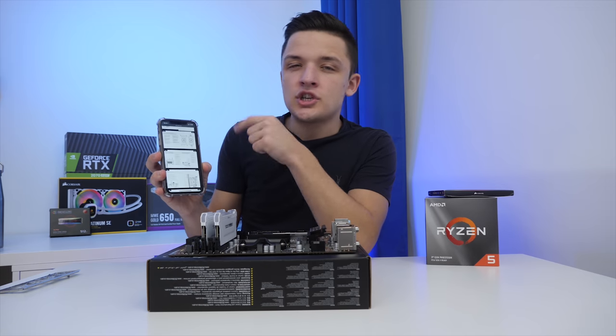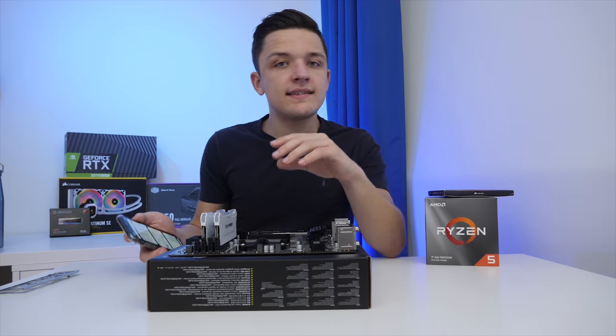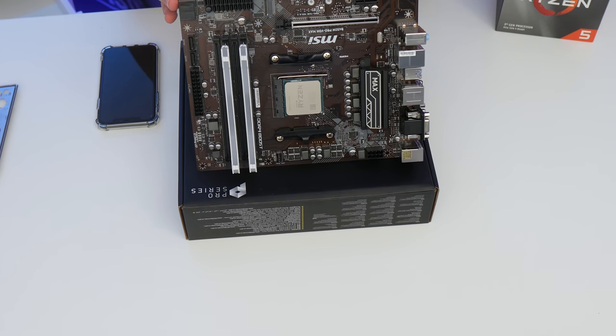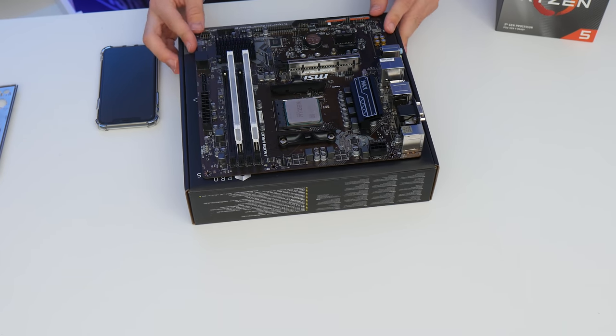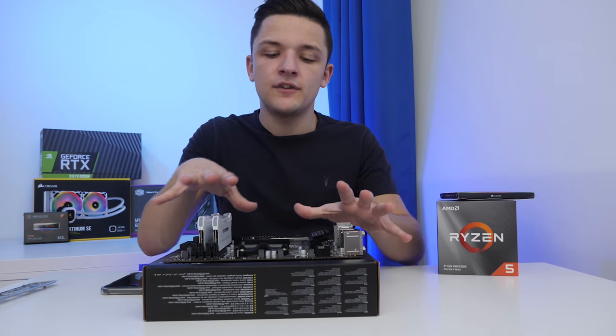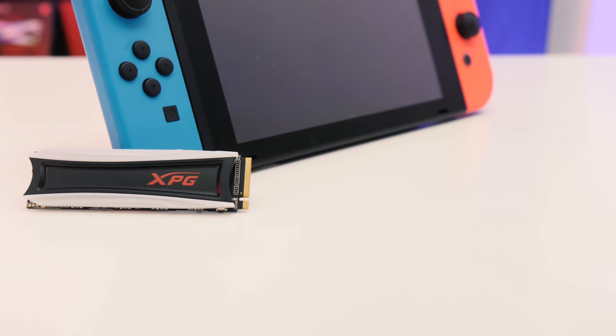One thing I'm actually doing here is just checking the manual for our CPU cooler installation, and it turns out that Corsair allow you to use the pre-existing mounting brackets that come on top of your motherboard, which is going to save us loads of time and hassle. That means we only have one more thing to do before moving this motherboard assembly into the case, and that is to install our M.2 SSD.